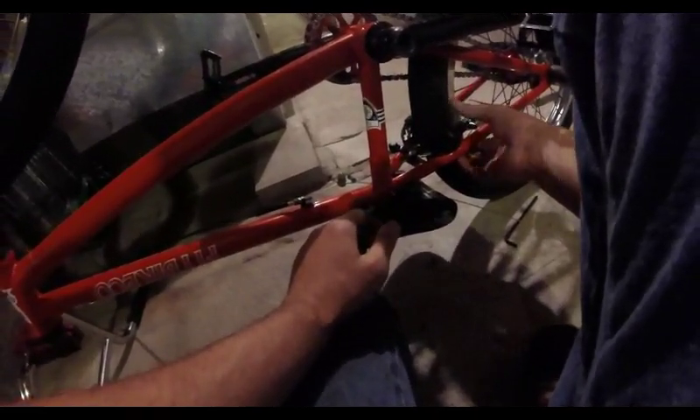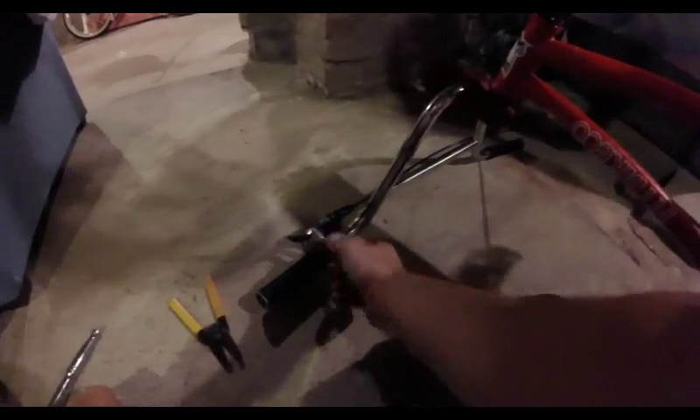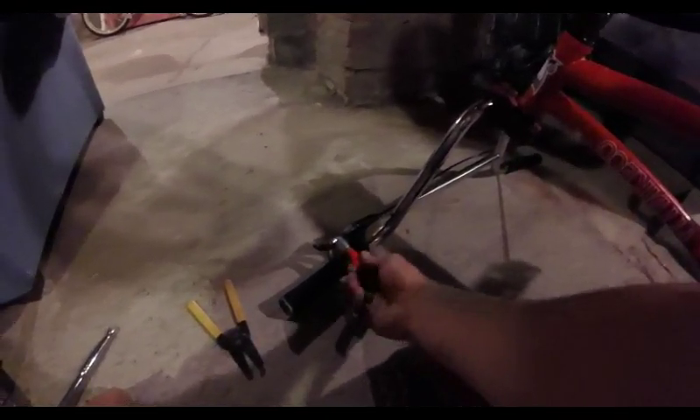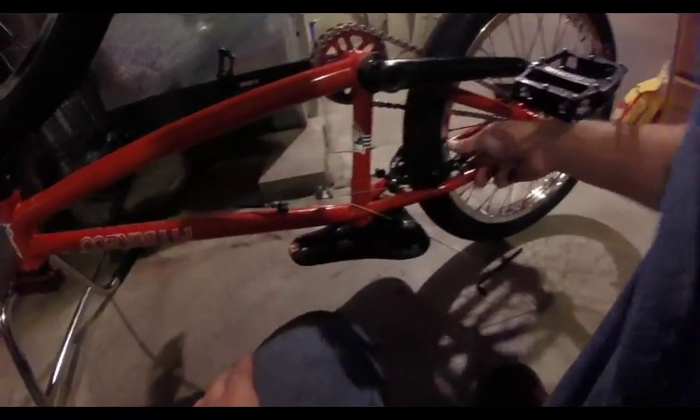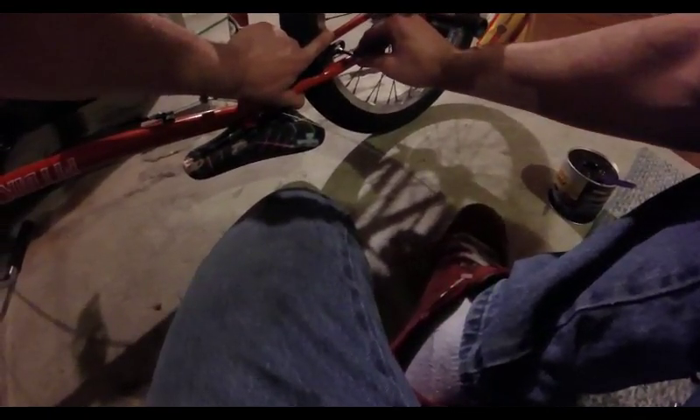Now you can come back to the brake pad and you can see it's still kind of loose — adjust your brake pad a little bit more. I've got one of these keyed hose clamps; you can just continue to tighten the hose clamp down and pull your brakes tighter and tighter. Do this for each side. Now take your hand and actually hold that brake pad from rotating, since that hose clamp is holding the lever for you. Just take your finger and keep that brake pad from turning on you.